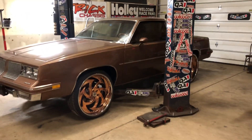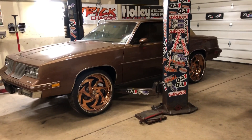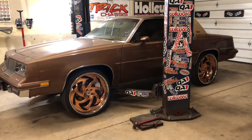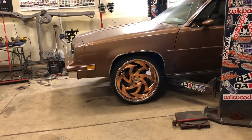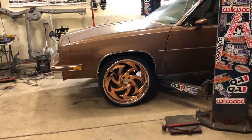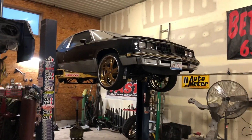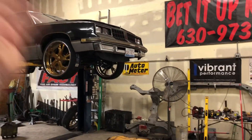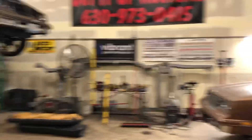Get right back on this so I can get this ass-end done. This is an 85-86 Cutlass, just a V6 car. All the front suspension is done, the notch is done in the front, full turn. I did trim the fender and move the chrome forward — there's a bigger tire, whatever. On Cutlasses, you got to trim the fender. So like that Cutlass there, I'm going to have to trim the fender and it's got no chrome to it. But I'll trim it nice, not all packed up. I'll show that when it's done — of course I'll get an outside video of that one.